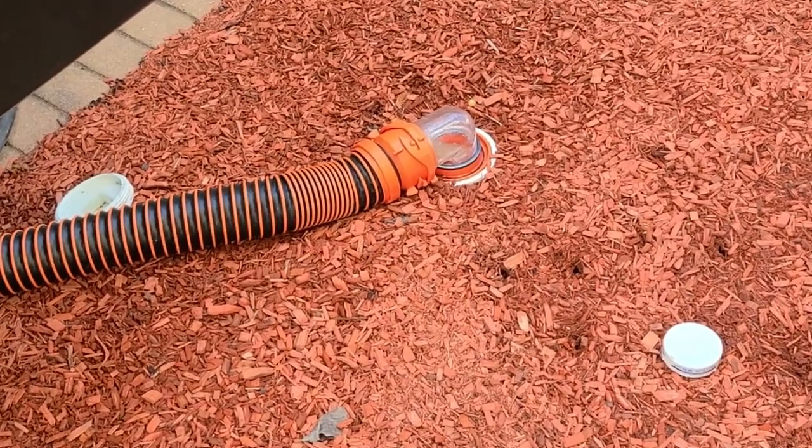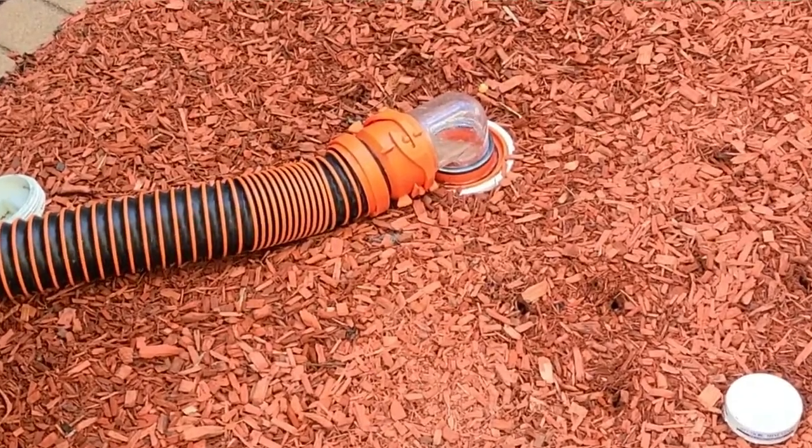After I've dumped the tanks and want to flush the black tank, I like to add a little Dawn dishwashing soap to the commode, clean the commode, then flush it, and turn on the water to the black tank flush. Using a flashlight, I look down the toilet until I see suds coming up in the tube that comes up from the tank into the toilet. At that point I like to let it set overnight. The next day I dump the tank — you'll be amazed what comes out, it's not pretty. Then I turn the water on to the flush system and continue running it until everything runs clear.